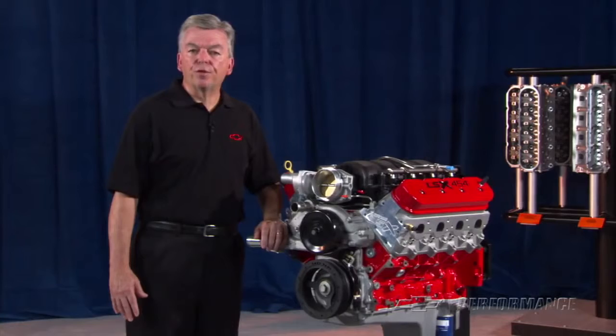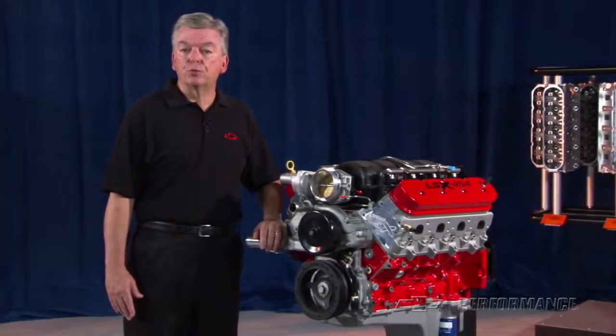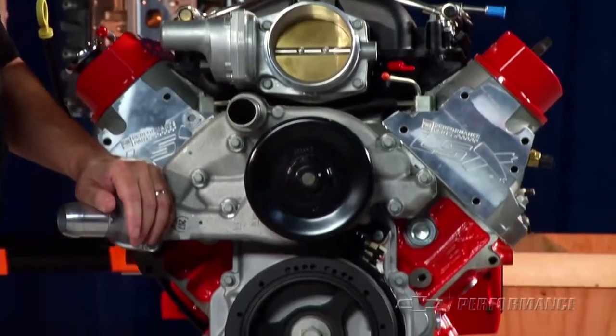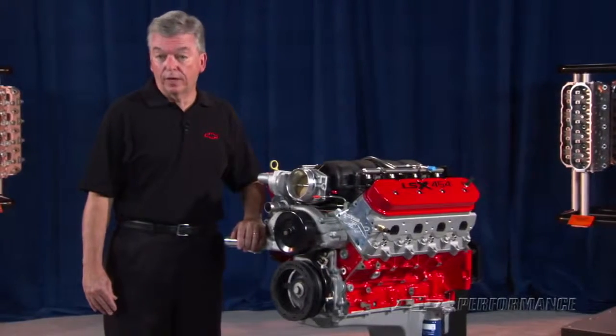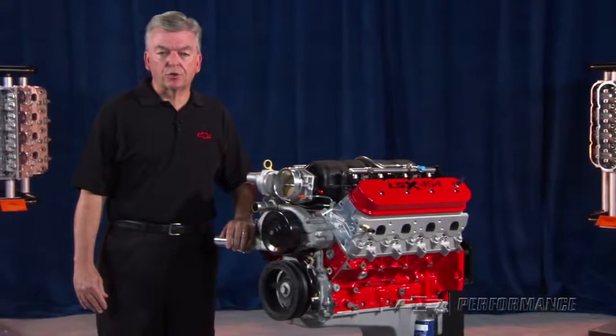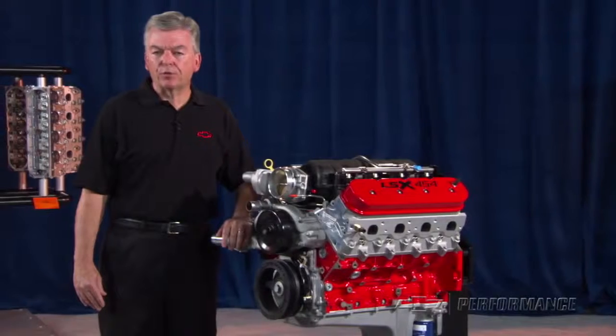The LSX454 has an 8-bolt crank flange that may require an adapter for use with some transmissions. The LSX454 requires the purchase of an oil pan as the engine is shipped with a sheet metal crankcase cover only. Although the LSX454 is built from the best and strongest components available, the relatively high 11:1 compression ratio is